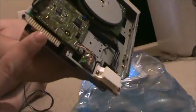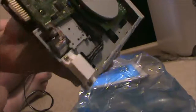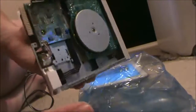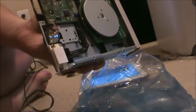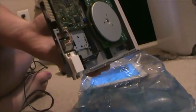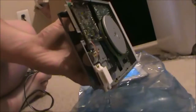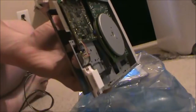Like I said, it uses a card edge connector. The seller does warn you about this when you buy the drive — you need a card edge connector to actually use it. So keep that in mind: if you want a 5.25-inch drive, make sure you get a card edge connector. The connector is not the same as your typical 3.5-inch drive, but the interface is exactly the same, so you could actually make your own cable if you wanted to. One end needs to be your typical 3.5-inch floppy drive connector, and the other just needs to be card edge. You can also buy these cables on the internet — I'll put a link below.